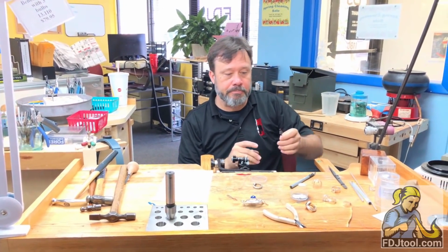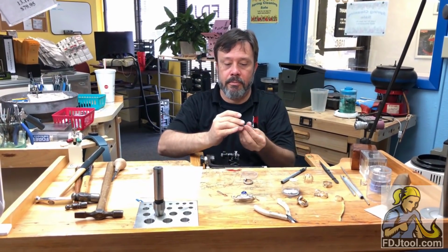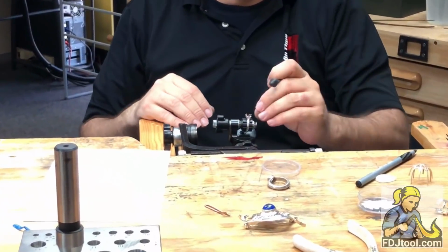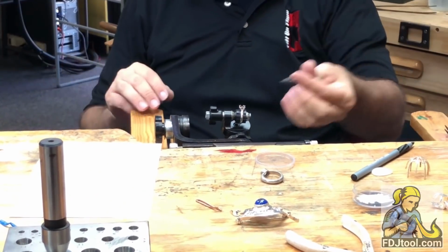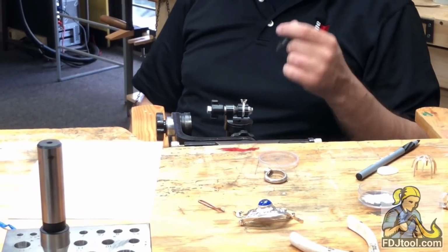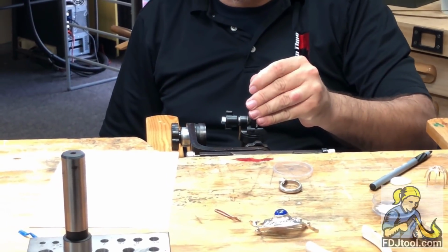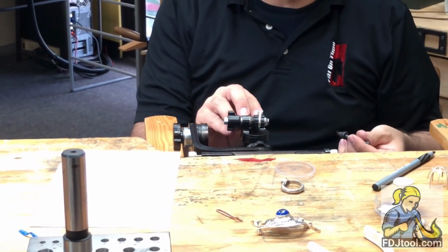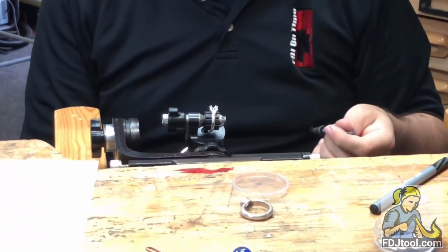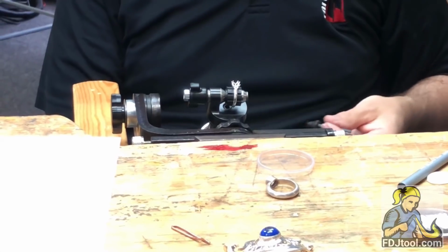All right. So you'll have that on hand, and it's a nice hold. You can put that in, put your fingernail on top, and then you can take a look. Another really good piece of advice is check everything often. You're going to have this while you're cutting your seats. You're going to put this in, check it, take it back out. You're going to work for 30 seconds, put the stone back in, check it, take it back out, constantly.